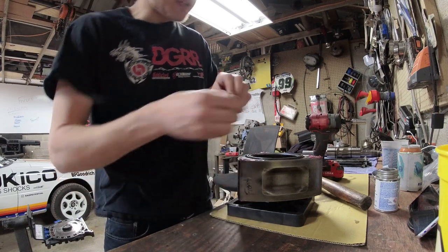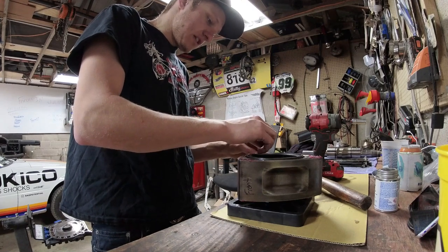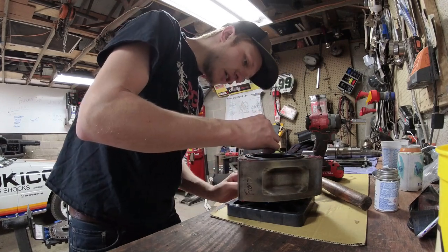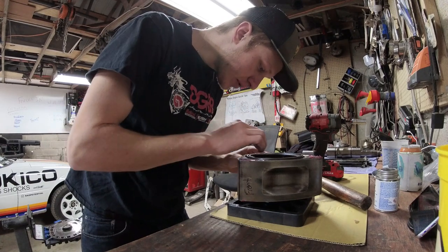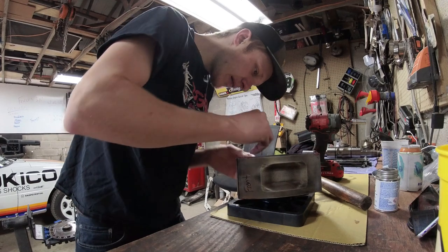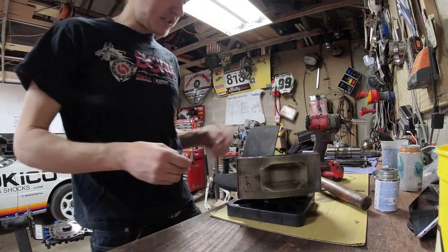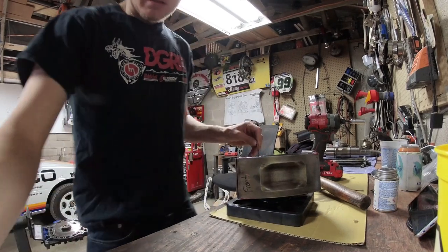The reason we do this is because when you set the rotor in the housing and go to drop in your apex seals, if they're not straight you'll have a real pain trying to fix it. Right here I have a corner seal spring that's not lined up — I'd have been very mad if that happened with the housing already on, because it's really hard to straighten without pulling the whole rotor back out.